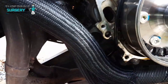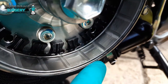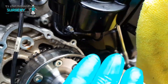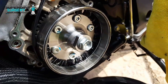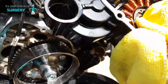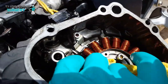Okay. After a closer inspection - you know I said this dowel was missing - I didn't really pay enough attention because it was all oily. Look at that - there's a little bloody scraping mark there. Which would explain why I was saying I thought I could feel it on the outside - it was like it was on the outside of the cover. So what it looks like has been happening - and I've been going completely down the wrong path thinking about this sprag clutch - is it's been rubbing on the stator winding, which is obviously bolted to the outside of that cover. So that would kind of explain it.